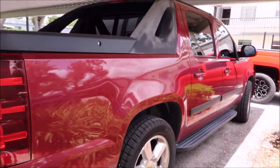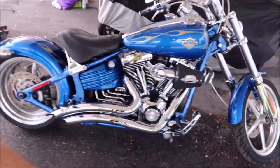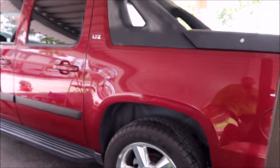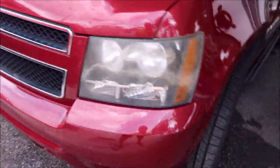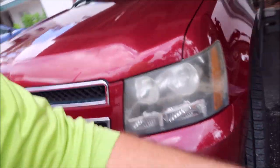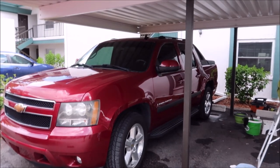Back on this Avalanche — just completed the Harley Davidson Rocker C. Tony has been working on this Avalanche: she washed, clay barred, got everything dry, and cleaned the wheels and tires. The next step is I'm going to put her on the Universal All-in-One polish while I straighten out these headlights. I'm going to sand them down with 2000 grit, then finish with Infinite Cut, and then apply the One System coatings — the entire truck is getting the One System coatings as well.